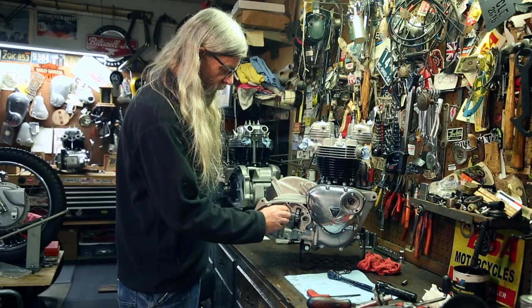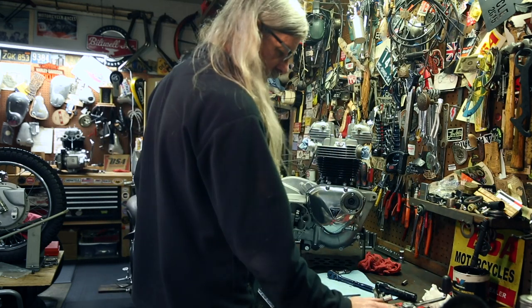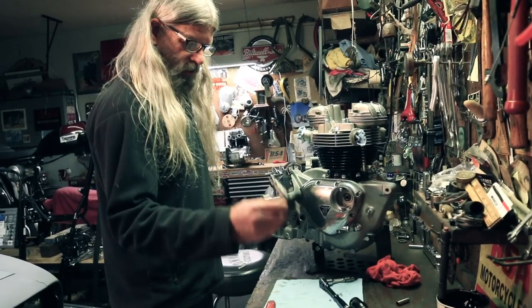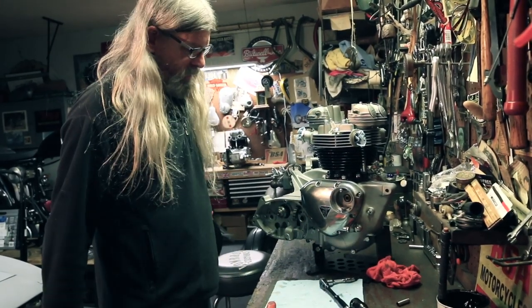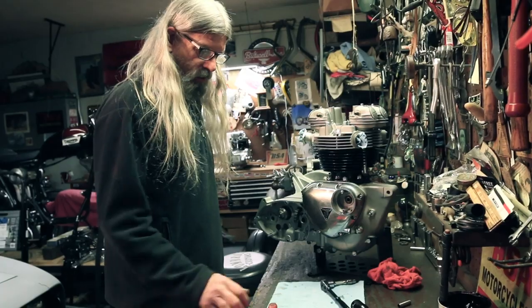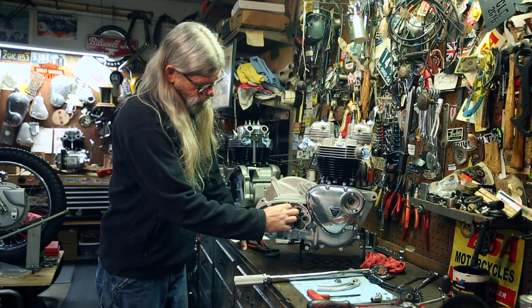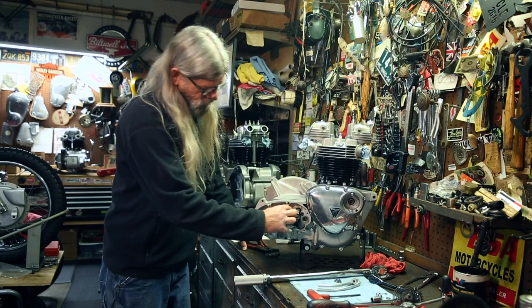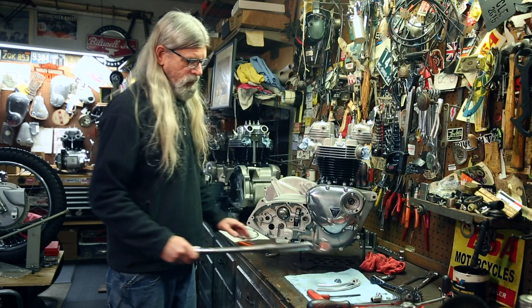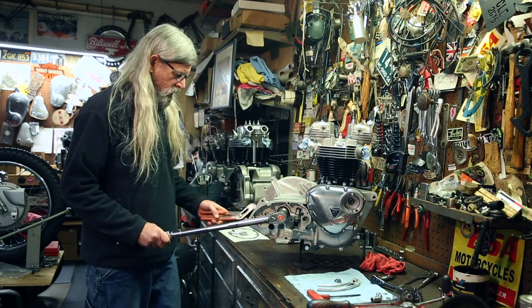We're gonna tighten this nut. We're gonna put a gasket on here. We're gonna install this kicker gear. We'll show you how to wind that baby up so she's tensioned correctly. And we'll be done with this portion here today. We need to torque this nut for the kicker gear. Make sure you got that spring located correctly where that ratcheting gear springs back. Torque spec is 45 foot-pounds.